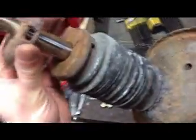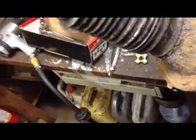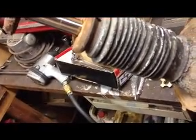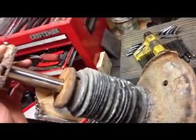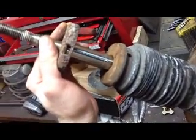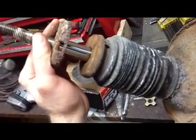Now we can take this apart, hopefully inspect the shock. If it collapses of its own weight like it's doing there, probably time to replace it. So you can see it slowly dropping down. It should be stiff enough. If anything, it should be slightly pressurized to the positive side. So the fact that I can compress it just by the weight of my hand on there, I'm not pushing down on it at all, indicates that it's perished. So we're going to replace those too.